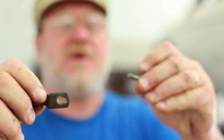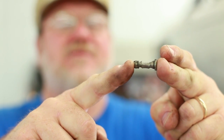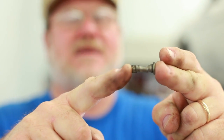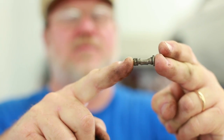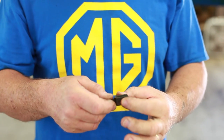And the clevis pin was this worn. Okay, so that's even more worn. The pedal, of course, looked a lot like this too, but there wasn't anything we could do with the pedal. We were able to find another push rod that wasn't so worn, and we were able to find another clevis pin, certainly. But the combination of these 2 things allows for so much lost motion.